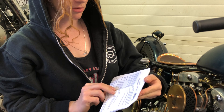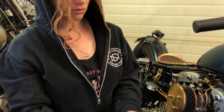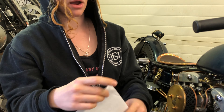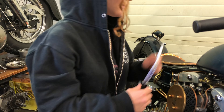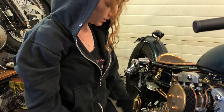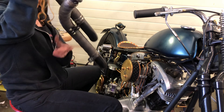What I have for ignition is an Ultima programmable ignition in the cone there. I think I need to play around with my timing a little bit. It's static timed right now, but I feel like it could be slightly more advanced. If something sounds weird, let me know what you think. Anyway, let's get this done.